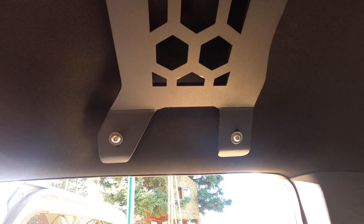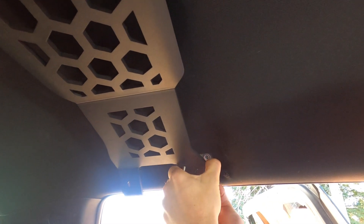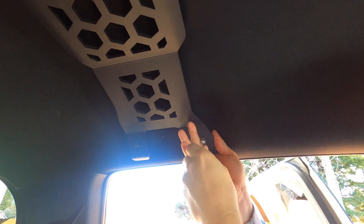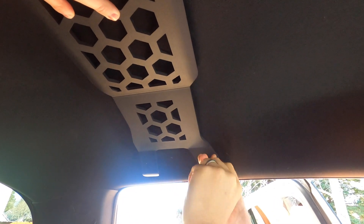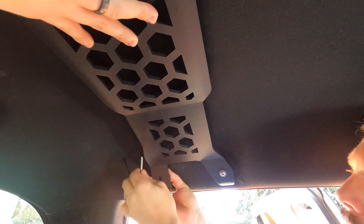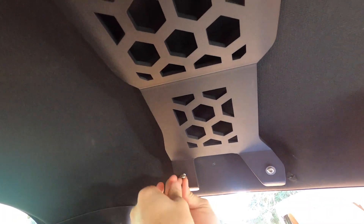Leave it a little loose until you get to the other side, then tighten everything down. Working our way to the other side now — take our spacer, put it behind, take our bolt through the spacer, get it seated into the jack nut. Make sure you don't cross-thread this; it's a very tight fit. In fact, you might have to push up on the rack just to start the threads. The last one is going to be the hardest because all the other three bolts are already in. Go through there and tighten it down.